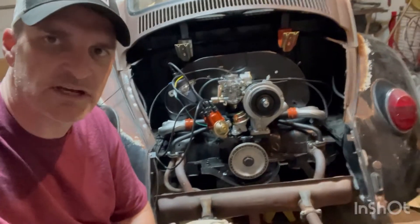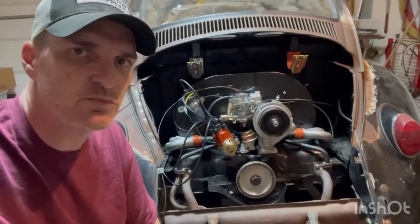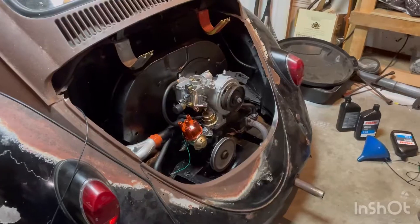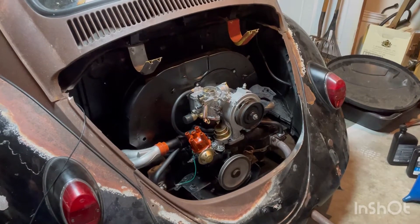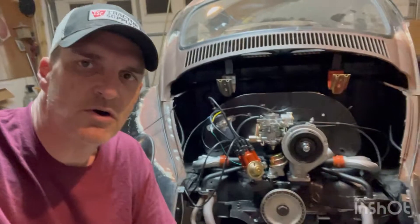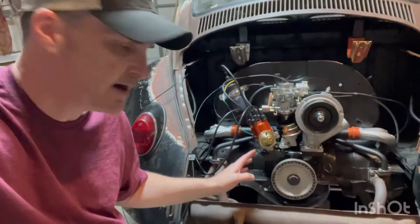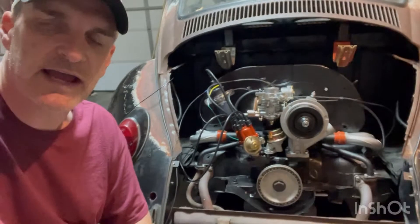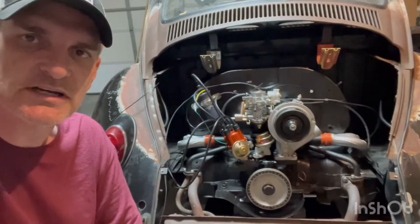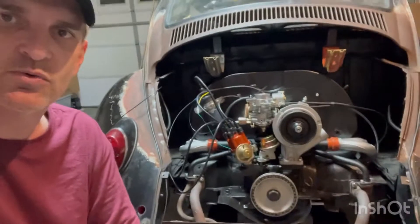What happened once I got it in was the old Bosch 12 volt starter that was in it was really dragging and just would not turn the engine over. So I crawled up under the car and checked the ground strap to the transmission to make sure it's grounded back to the frame. It wasn't grounded properly, so I cleaned it all up with a wire brush and mounted it right to the frame. Came back out, tried it again — no bueno, didn't go.